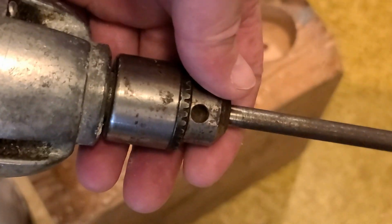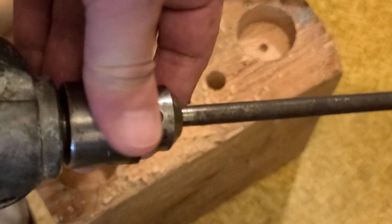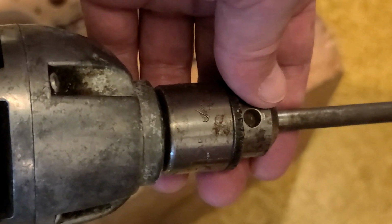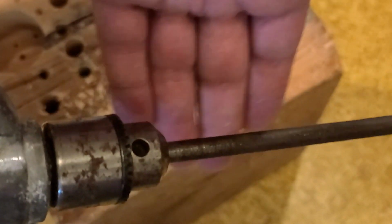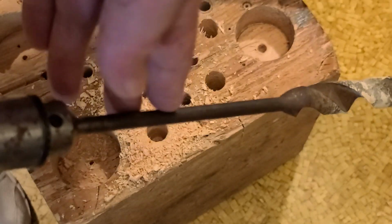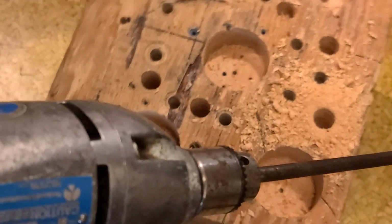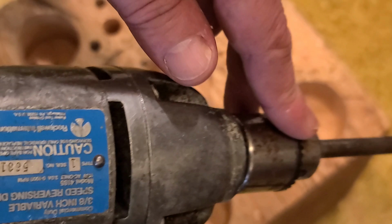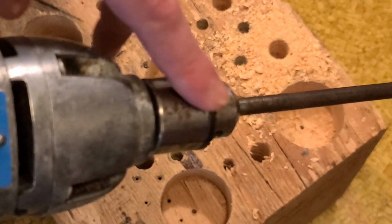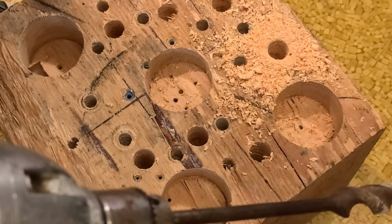The reason I complain so much about drill chucks is that this cheesy one here has such a small key that I can't physically tighten it, going around and around in all the holes to get it tight enough to actually prevent the bit from slipping. That's the biggest deal about those Jacobs industrial chucks, is that they're billet steel, so they maintain their alignment easier, so they actually deliver more of your torque to sending the teeth up and getting them tighter.